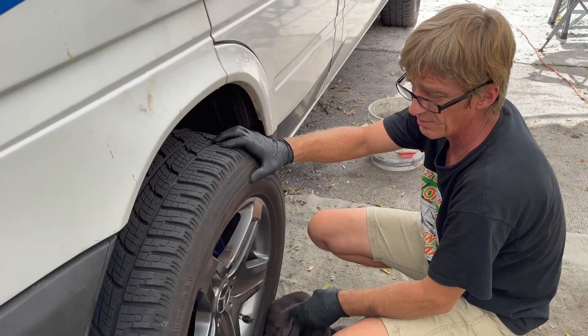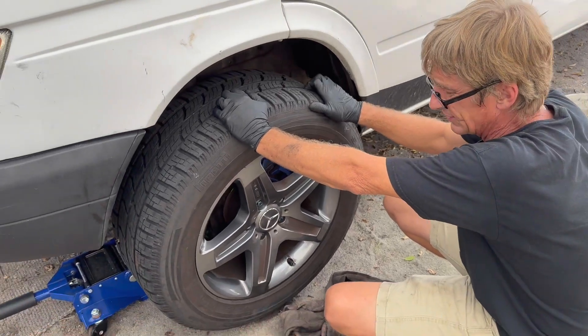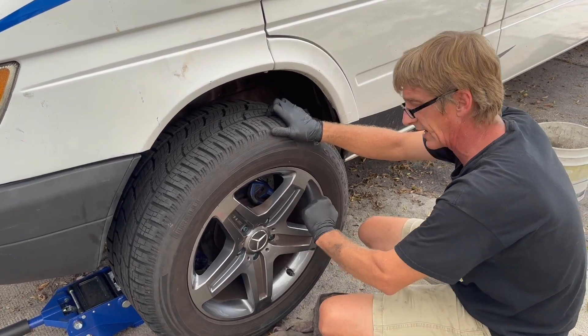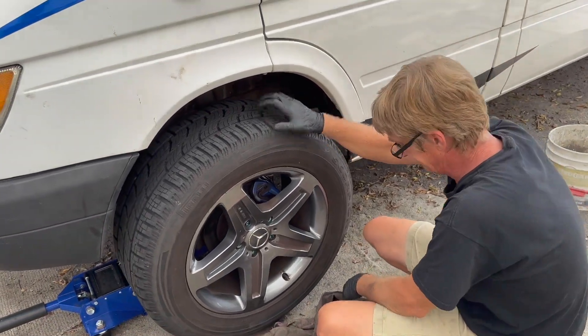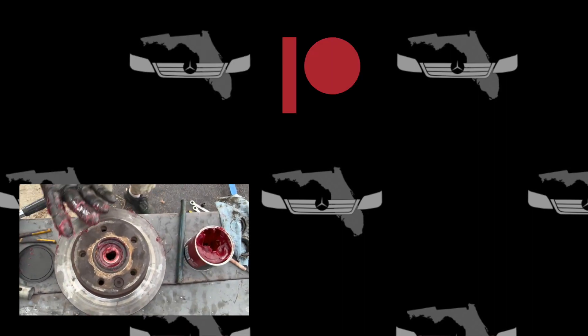To be smart about this, I'm going to take it for a drive — maybe 20 miles at the most — and then take this wheel back off, make sure that nut is still good and tight. We adjusted it tight and then backed up and snugged it up again; going to make sure that's as tight as it needs to be. That's it.